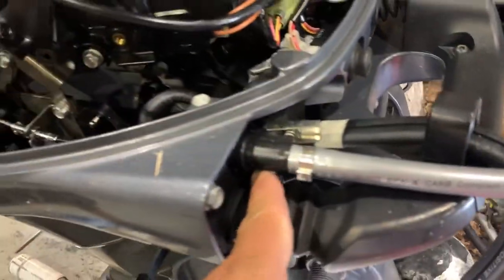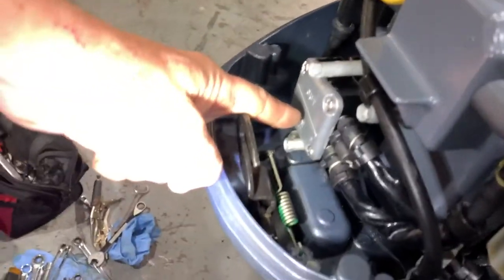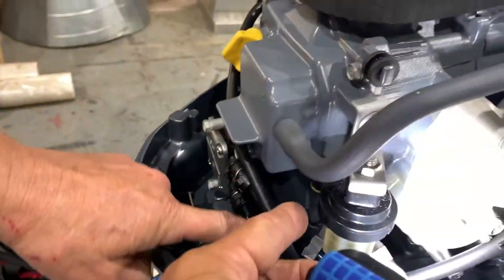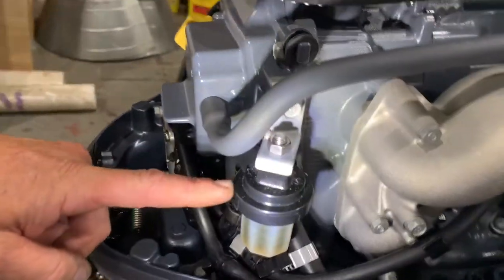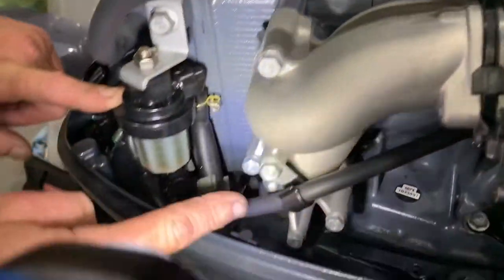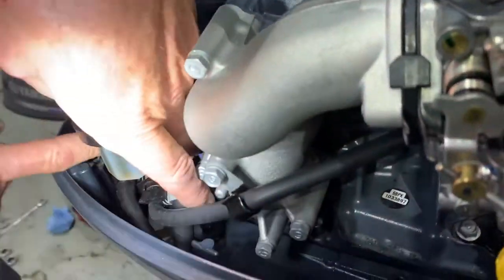Okay. We've got a gas line coming from our gas tank. That's right. It goes up into the intake here. And following the little black hose there, down all the way back to the back through the fuel pump. Is that right? That's correct. Pumps it back out through the fuel filter. That's right. Then down. And then, that's this guy here. Got it.